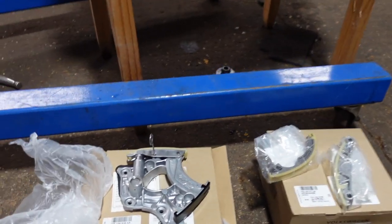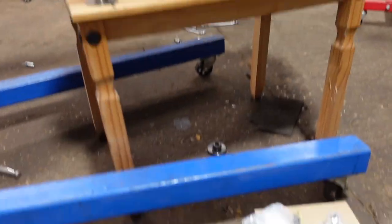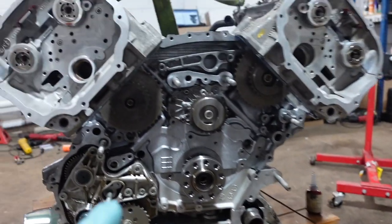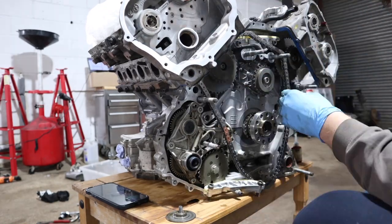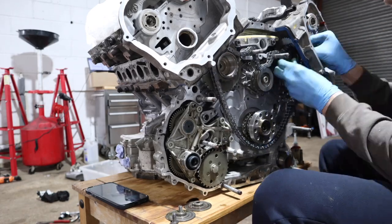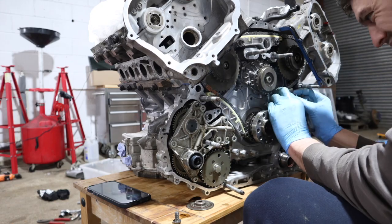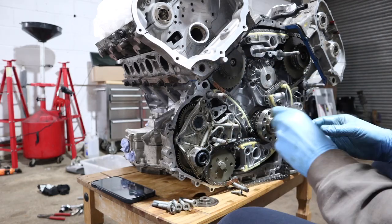We've got two tensioners - one for each head - which are the main tensioners that sit behind there, plus guides and a few more tensioners, and all the chains. I had two chains that are nearly the same length so I had to work out which went where. The sprockets cannot go on first; you have to put them on with the chain, otherwise they just will not fit under the head. The good thing about the main chain and the oil pump drive chain is they don't need to be timed - they're just link chains and the oil pump doesn't need timing. You can just pull the pins on the tensioners and they're done straight away.